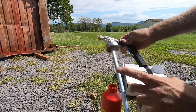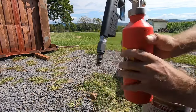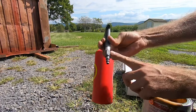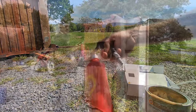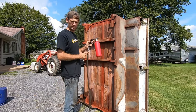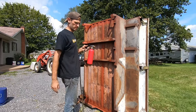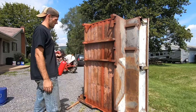I'm going to skip the extensions and spray the flat sections first, and then throw a hose on it and spray up inside the bed pockets. It has a quarter-inch pipe thread nipple on the end to put your air hose fitting, whatever style you use in your shop. I've got the gun hooked up to my shop air — I have it on a regulator with a dryer and it's at about 50 pounds. I think it said the max PSI is 60. I'm not going to touch any adjustments and just see how it sprays right out of the box.